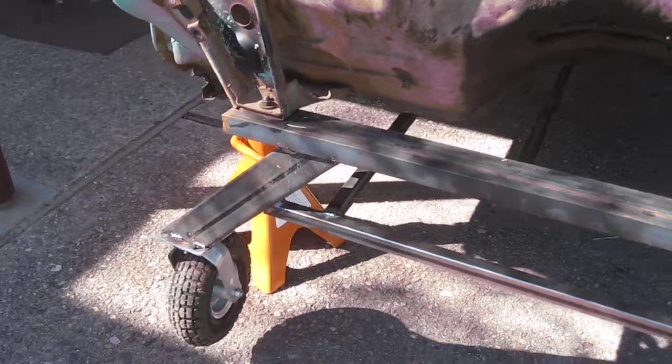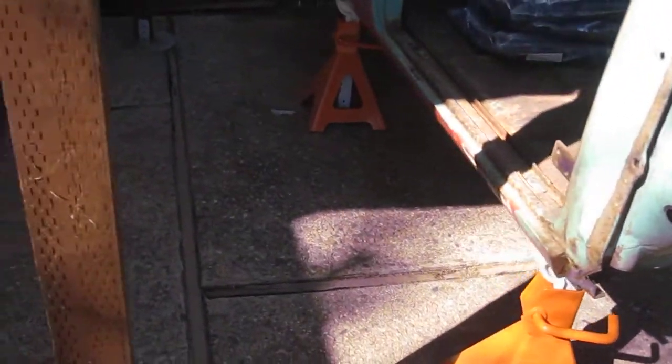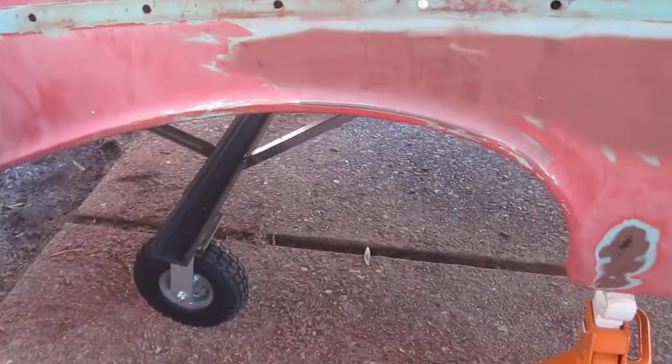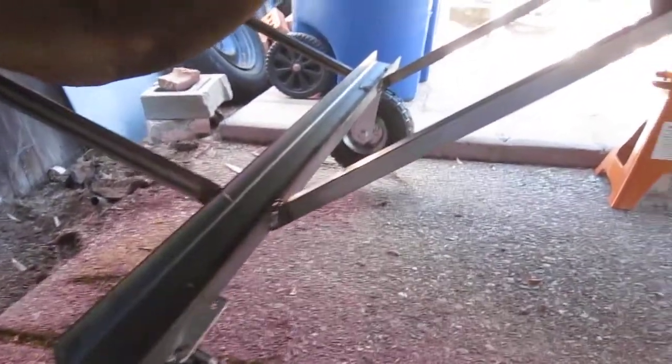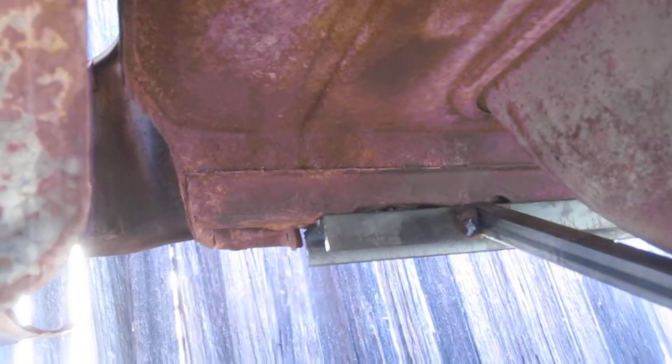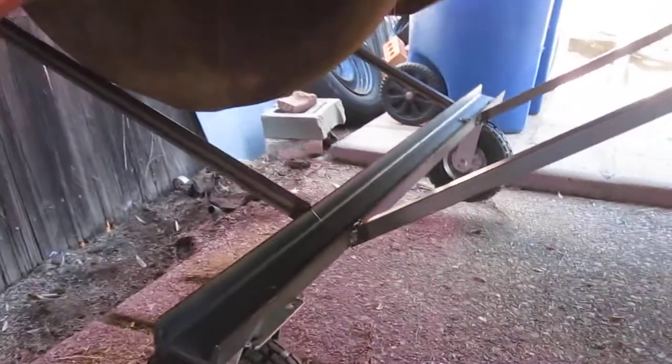It actually worked quite well, but I just didn't have the turning radius to maneuver it around. There's a rear piece of channel steel and some 1 inch tubular steel. That's the rear body mount behind the rear seat, and then this strut over here goes to another piece of channel that's bolted to the trunk body mount holes. I tried to keep it as straight as I could, doing some measuring to make sure it was going to be in line, fairly straight up and down, so the forces on it weren't going to be too much. And it worked well as far as that goes.